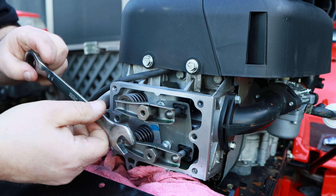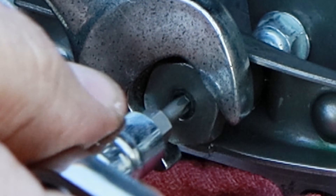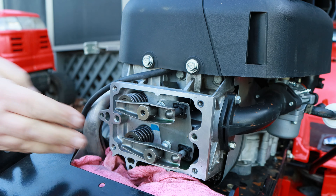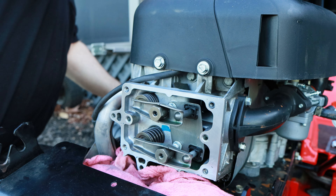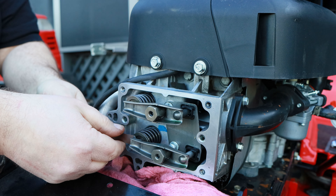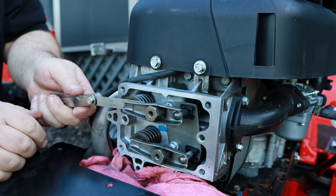We're going to hold this — don't let it move when you put your wrench on it — and tighten that center jam nut back up. Don't over tighten this; it just needs to be snug so it doesn't vibrate loose. And you've got your valve set. Now what I like to do is just turn the engine over once or twice. Don't leave this in here when you're turning it all the way over. Get your piston back in position and just recheck them once before you put the valve cover back on. There's three thousandths right there, and that should be five thousandths right there. So we're good to go.